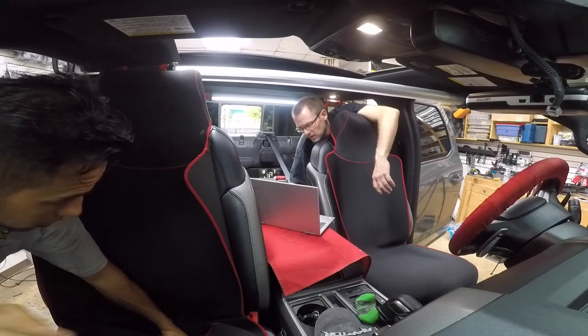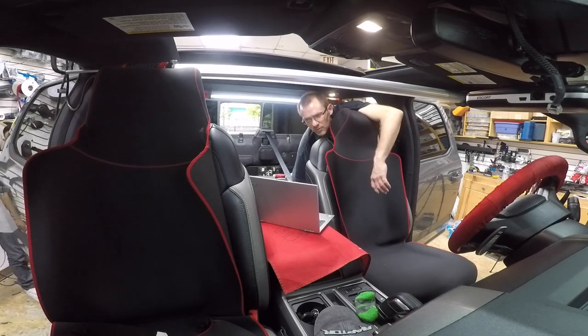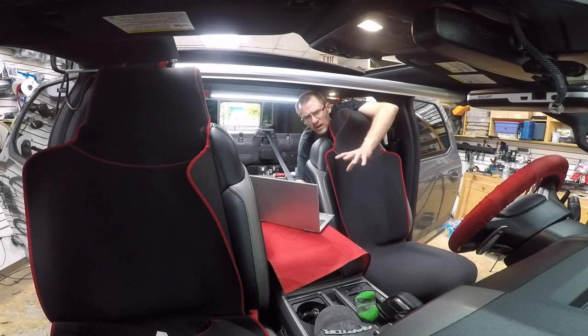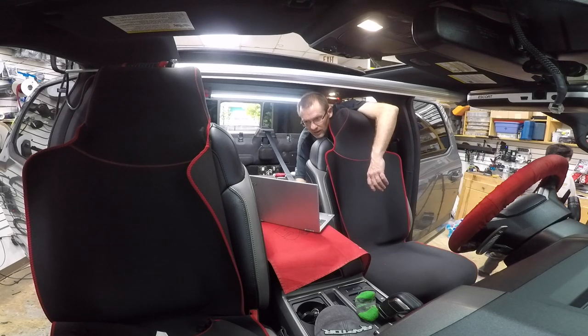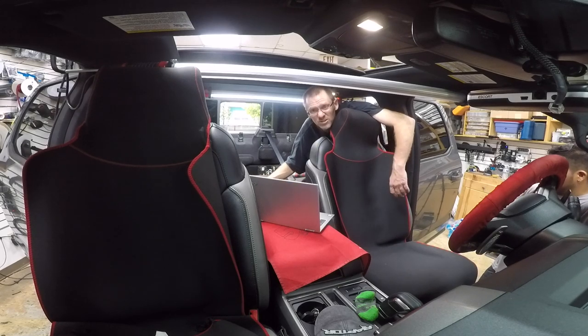Then we're going to do a polarity test, then the SMD DD1, then some RTA. It's a whole checklist of stuff we have to go through. The DM608 comes with this blue USB cable — plug it into your 608, launch the software. We're using a Windows machine because he's a Windows user. It'll automatically recognize that it's not up to date, ask you, and you just click yes. Don't accidentally turn off the car. Now we just sit back and wait. Device successfully updated — rebooting now. Select OK. When you're setting one of these up, click on Output Channels. If you right-click over them, it'll let you label them. One and two is front, three and four is rear, five and six are subwoofer, seven and eight are nothing.